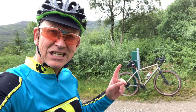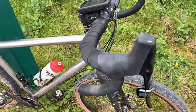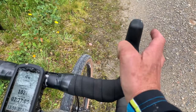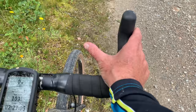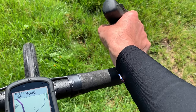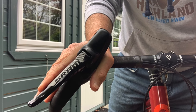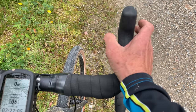A few thoughts about the bike — as you can see I've ditched the gravel-specific handlebars and gone back to road handlebars; these are off a Specialised Roubaix. I've done a dreadful wrapping job on the bar tape on the right side. The reason is my thumb joint has been getting quite inflamed. On a road bar I can put my weight through the heel of my hand and cover the brakes just by sliding forwards. With the gravel-specific bars, because they were flared, I found I had to wedge that part of my hand into the hood, so on rough road a lot of vibration was coming through there, and I think that's the reason for that joint being so inflamed. I can't say for sure that's the cause, but after this first ride with these bars, my hand feels a lot better.